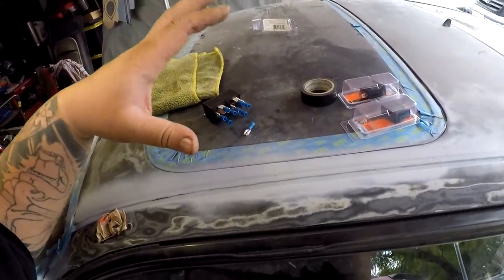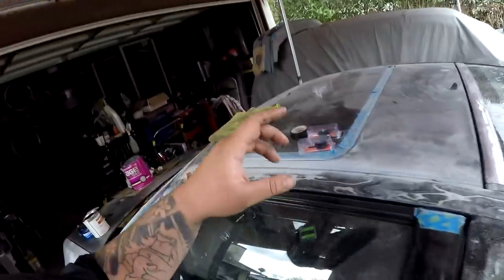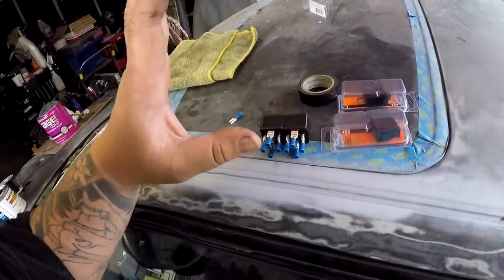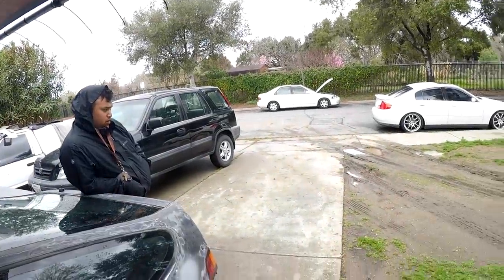So this is the ghetto-right way of doing things, and this will get him by until the race is all done, before we diagnose the car and figure it out correctly. I'm almost certain his ignition switch is bad, because last night I checked the white wire that goes to the switch, which is the power wire. It has a nice solder crack on it, and I'm almost certain the rest of the stuff is not getting power because of that. Ignition 1, 2, accessory, and so on. The car runs and drives just fine the way I did it last night, so doing it semi-correctly would not hurt a thing, other than being safer with the correct amount of volts going to the needed places.